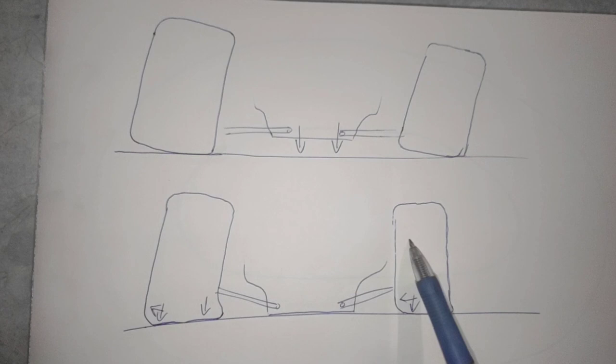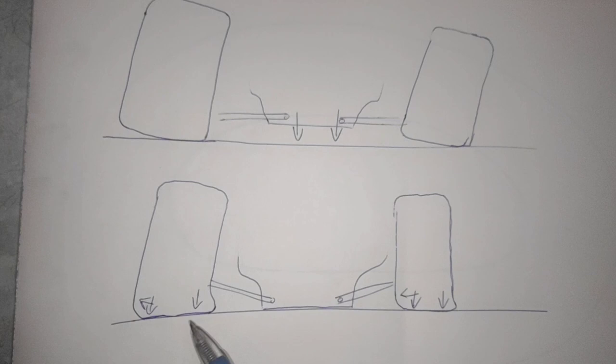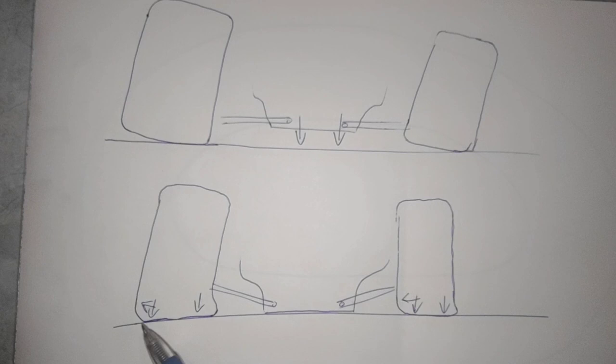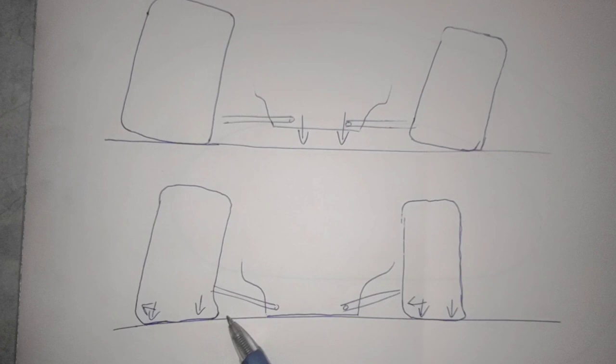The right front sees a ton more load, well, maybe not quite a ton more, but it's definitely seeing several hundred, maybe 1,000 pounds more load. What it's doing is it's deforming, and by pushing this tire into the ground, it deforms, it increases the footprint of this tire, and it's more effective because it's using the inside and the outside of this tire. The left front tire, however, stands up because it doesn't have near the amount of load. It still sees this distortion, but it's not quite as bad as the right front because of the lower load